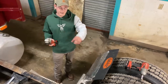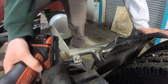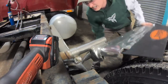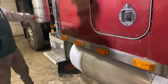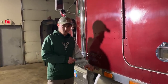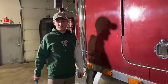The passenger fender — we're not screwing with it, we're just going to grind it out. We just finished ripping off the rear fenders, the quarter fenders, and the mud flap brackets. Now we're going to take these off and turn our attention to the front half of the truck. We noticed these are actually huck riveted on, which tells us either somebody had access to a huck rivet gun — highly unlikely since they're super expensive — or these came on when the truck was new. Being that this is a 1990, these things have been on here a while, so it's probably going to be a pain to get off.